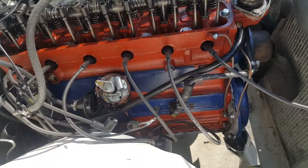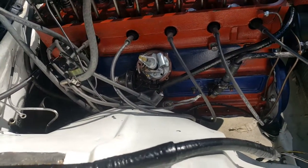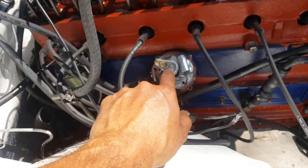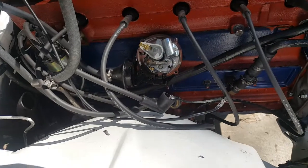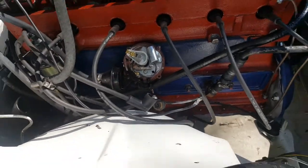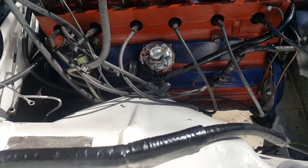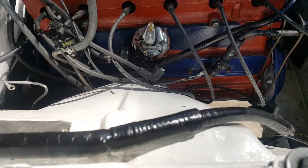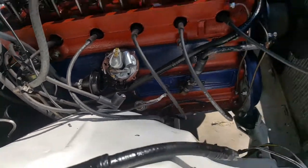I've been having some trouble with the timing and the engine will not start. I opened the distributor cap and although I originally had the cap in the right position, when I opened it, it was now in the wrong position. So I asked my assistant to crank the engine to see which way it turns. It actually turns counterclockwise, so the manual is correct.